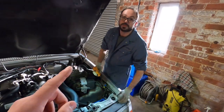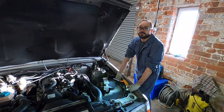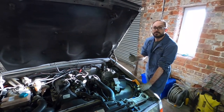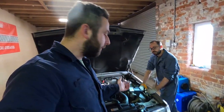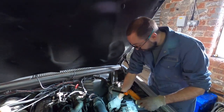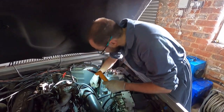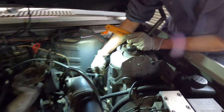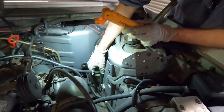So far with this one we've got: battery not secure, seat belt buckles were trapped, and reverse lights are intermittent - but they're not actually needed for an MOT anyway. We need to take the air fresheners out as well. Also: check wiring to make sure nothing is chafing. There's a fuel pipe here that's just come out of its clip, so we'll sort that out later - that needs to be put back in.